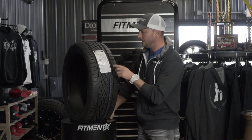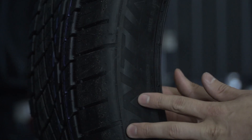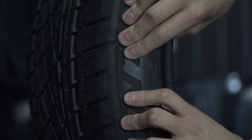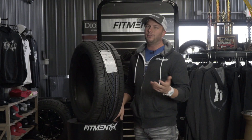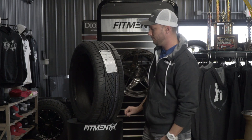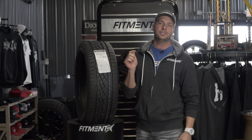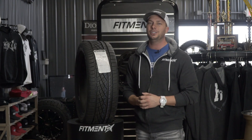Let's take a look at the sidewall — we're looking at a 245/45/20, just to give you guys a reference. This is a customer tire we're going to mount and get balanced shortly on an aftermarket wheel. The DWS is going to have a little bit softer sidewall, so if you pull it out it's pretty darn stretchy. For those of you wondering how the tire stretches, it's a lot easier to see in video — check out the actual tread, see what you guys think. If you have any questions, drop them in the comment box below. This is the Continental DWS 06 — we'll catch you guys next week, peace.